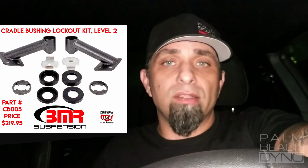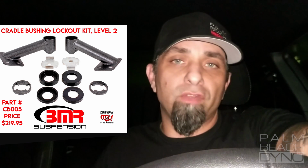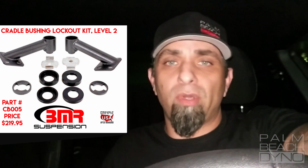The key to that is not only the tune, but I think more importantly is the BMR cradle lockouts. It's kind of transformed the car, and I'm using the word transform mostly because of the dollar per change. It's a fairly inexpensive part, and it's made the car much nicer to drive, in addition to the track and the lack of wheel hop issues. More importantly, I drive the car every day, and I'm only at the track once in a while. Driving the car every day, it's so much nicer. I don't have to worry about doing a hard 1-2 shift and getting excessive wheel hop.